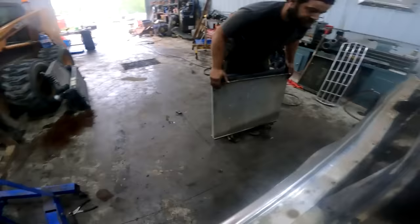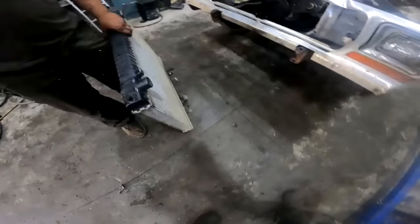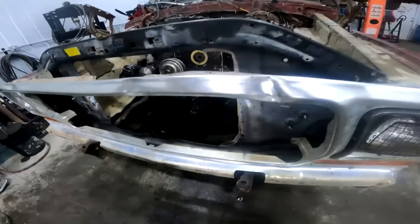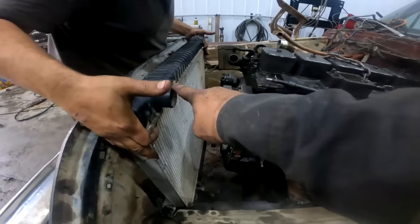So we went hobbling around for 4 hours looking through my giant piles of shit. We got shipping crate intercoolers of second gen and third gen or fourth gen. There's another one there. And then we come across a minty Power Stroke rad out of a '97. What we did here, we got her dialed out. It was a little bit too wide, so we just gaped the frame out a little bit because it likes that. And on this side, we also gaped the frame out. So the top rad hose is gonna be perfect. Gonna go from here over to there. I think we'll be able to use a second gen rad hose.